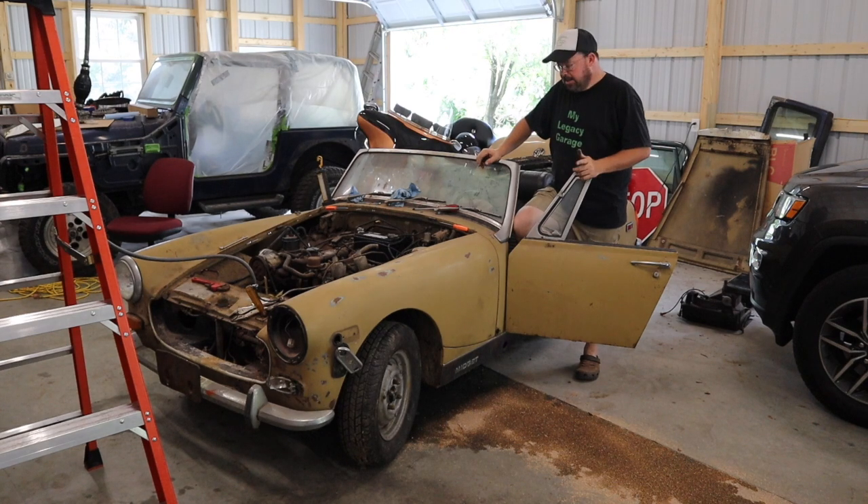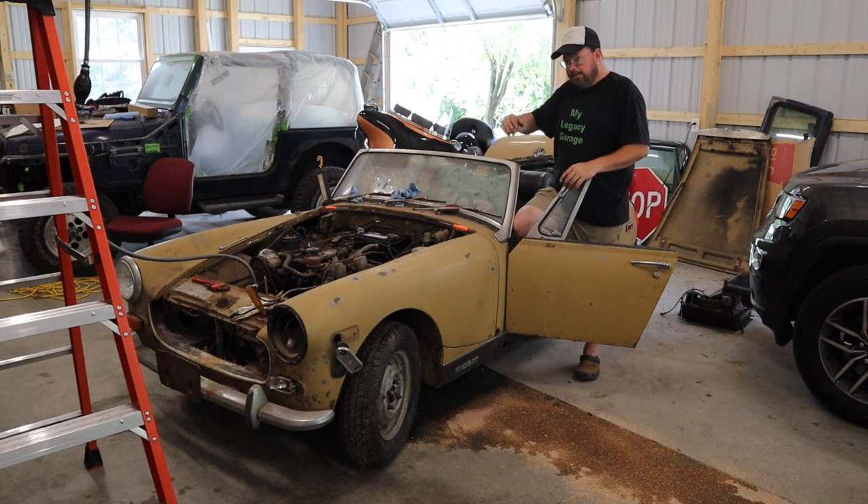I think that's going to be about it. It doesn't have a clutch — I think the slave cylinder is bad. There's fluid in the master but it's not engaging the clutch at all. It doesn't have brakes, which isn't really surprising. It has disc brakes in the front, which I didn't know about until I jacked it up and looked underneath. It also doesn't have a cooling system or a full fuel system. That's a lot of work to make it drivable, and work I don't necessarily want to do because I can't even get in and out of this thing. I think I'm just going to sell it. I bought it just because it was neat and hadn't been run in 40-something years, and I wanted to make it start. I did — it runs. Let's fire it up.